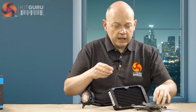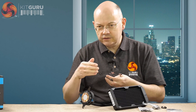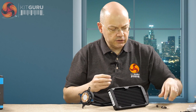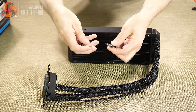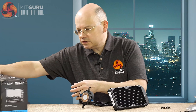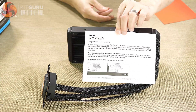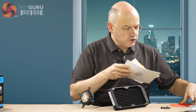You get a bunch of mounting hardware - the usual Intel backplate and a hold-down plate for AMD. You use the standard AMD backplate with some of the supplied mounts, so you swap one for the other. There are bags of fasteners, and notably special standoffs for Ryzen that I haven't seen before. Ryzen support was clearly added at the last moment - there's even an extra page in the user guide for it since it's not in the main manual. Follow those instructions and it all makes sense.